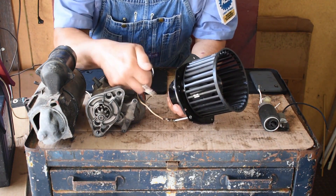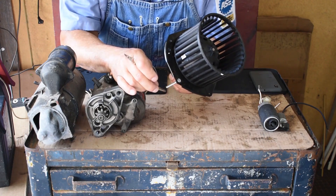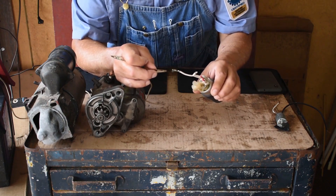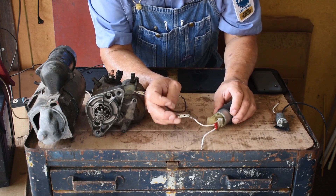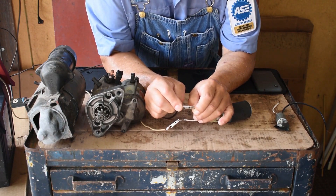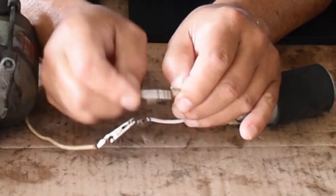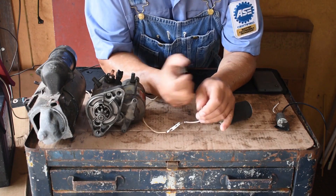I have to be very careful with these two jumpers. I'm comfortable working with these, and so long as they don't touch, I'm fine. Let me go to a smaller motor — this is a fuel pump motor. This is the average size of a fuel pump in your automobiles and your light trucks. You're not going to see anything obvious, but you will see the spark. And if I be quiet for a minute, I think you'll hear the motor. I want you to pay attention to the spark. Anybody want to guess how many volts that is? That's the easy one. Who wants to guess at how many amps there is?